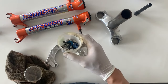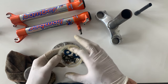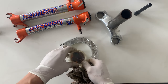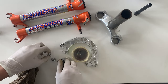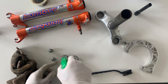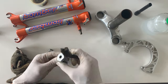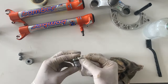Putting all the bolts I've taken off the forks into vapor rust to have them come out fresh. Giving the caps a quick brush-up using the detergent spray and a little wire brush to brush off all the debris and caked-on gunk. They came out pretty clean.